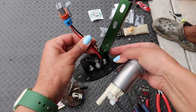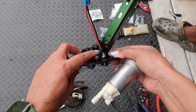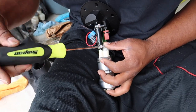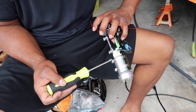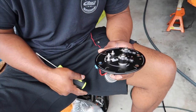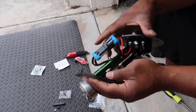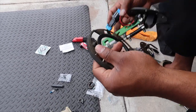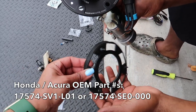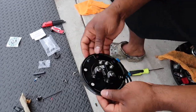On the inside this is connected here for pump one, and if you had the second pump it would connect here — positive and negative, they share the negative. Let's make sure it's straight. We're going to reuse the OEM fuel pump hanger seal — you can get this seal brand new from Honda or Acura.